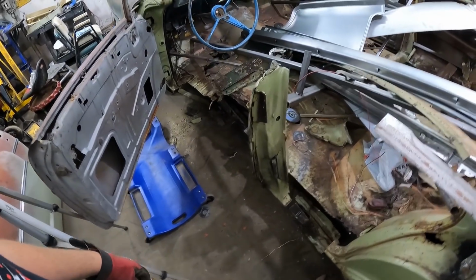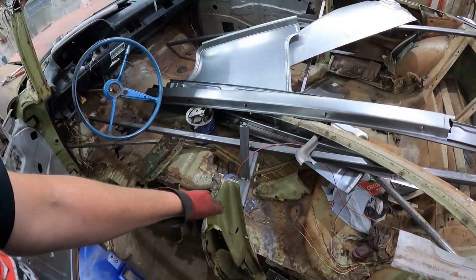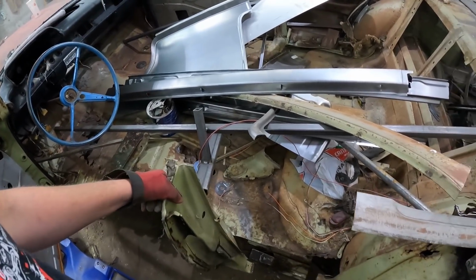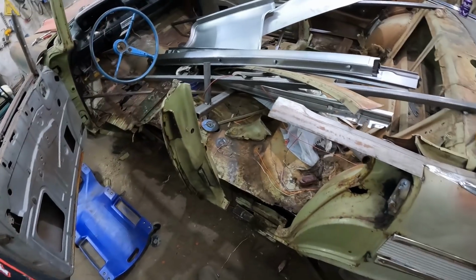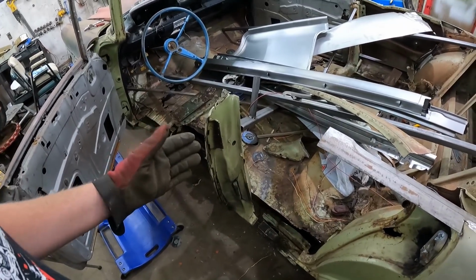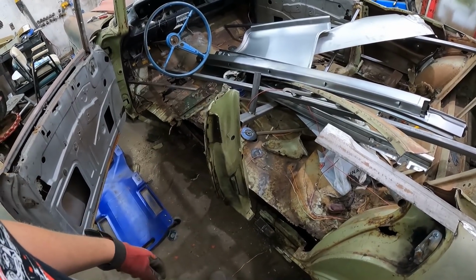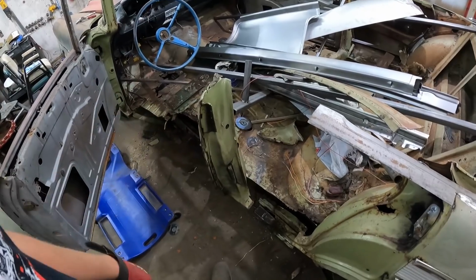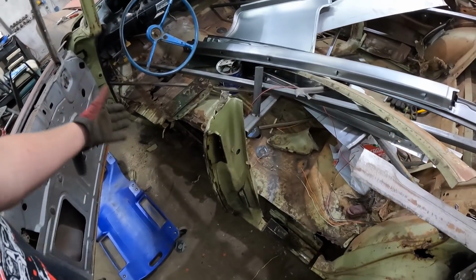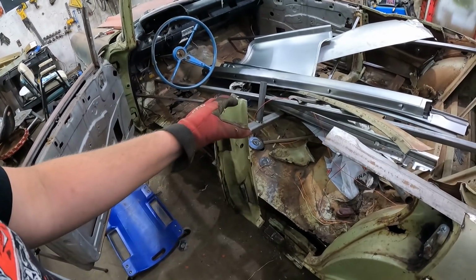Rockers come out. The post dropped just a hair, but I think that's just because it's got some weight on it and stuff, so it's not too bad. The whole car didn't twist, twang, bang, any of those things. It didn't jam the disc up when you're cutting. I always find if you're cutting and either the gap gets wider or it pulls the power of the grinder, she's getting tighter. Didn't do that. Really, what we took out there, there wasn't much strength to it. So whatever it has, it still has.